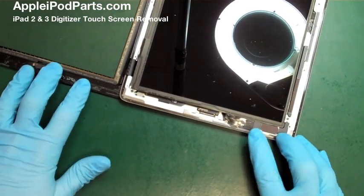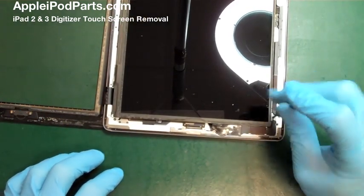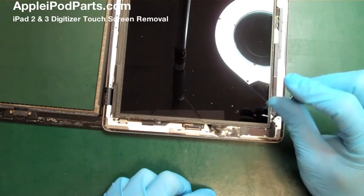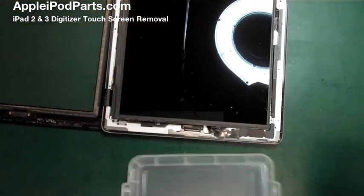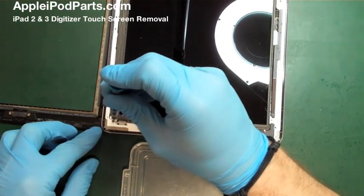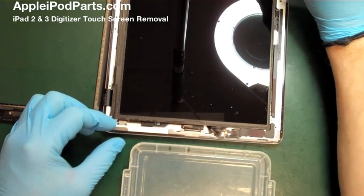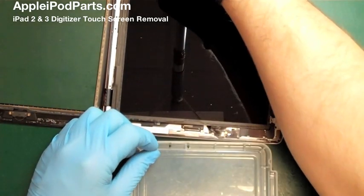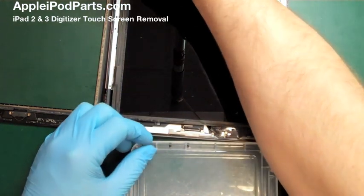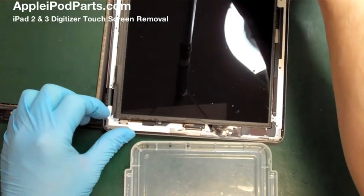Going all the way around the iPad, make sure the plastic surround hasn't got any dig marks in it. Removing the LCD is steady work — there are four Phillips head screws in the corners of the LCD. A little bit of manipulating and they come out with no problem at all. They're all the same length so you don't have to worry about where they go when they go back in.